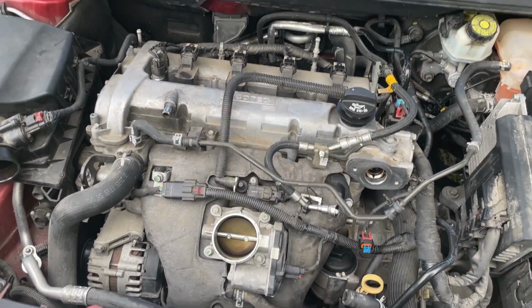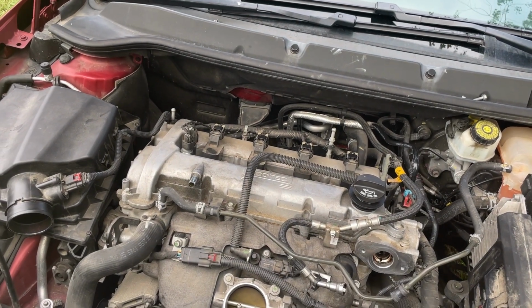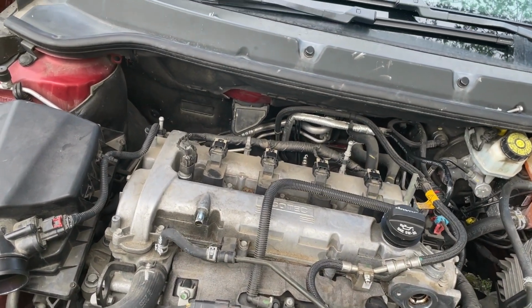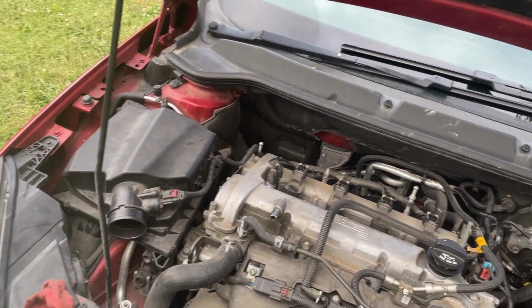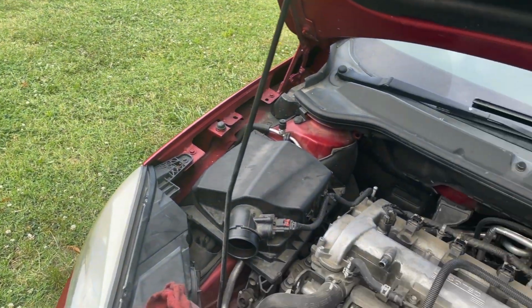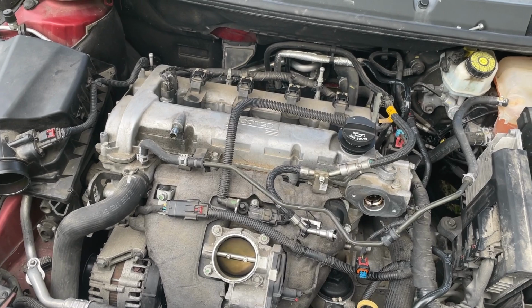So, came in, I did the converter. We did a fuel rail switch on this earlier this week. And I went through and I checked my O2s and everything. It's got a code for a bad O2 on the back. Of course, Bosch. Can't do Bosch on this car. It has to be Denso or NTK because that's what the original was.